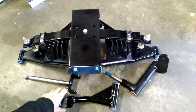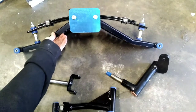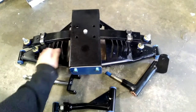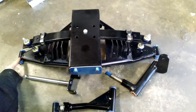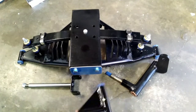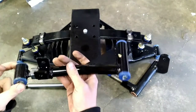Here's an overview of some of the main components of this kit. As you can see, it comes out of the package already pre-assembled with some very, very thick plate steel. Full A-arm — almost like a skid plate even. That's pretty heavy duty for this kit. You'll notice it's also got bushings at the end rather than those heim joints, which is pretty cool. This is a little bit different design — no heim joints, even on your control arms here. Pretty much the same design but with a greasable bushing at the end of it.